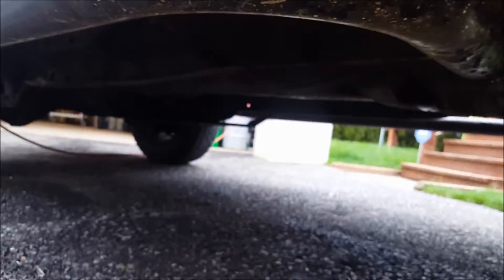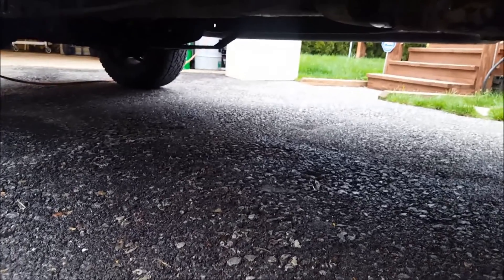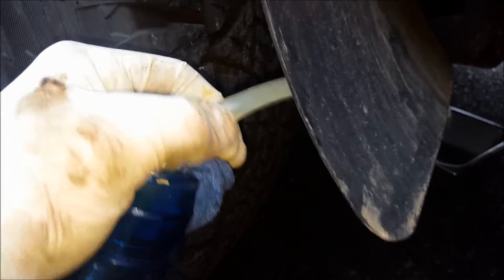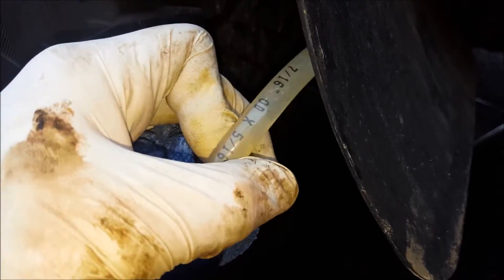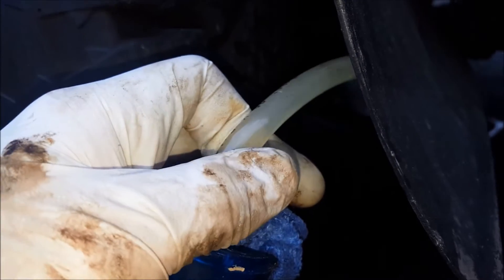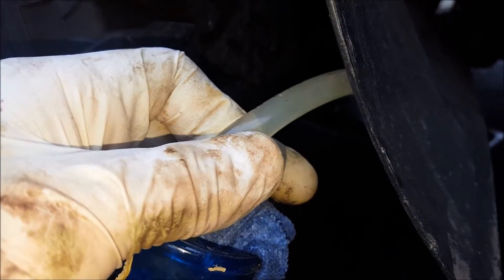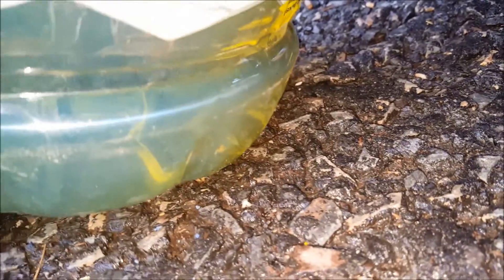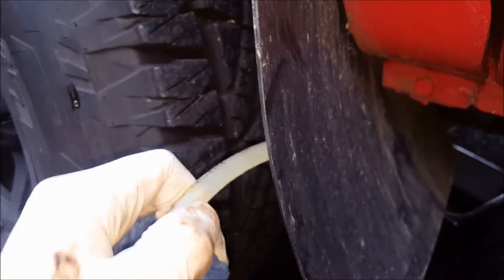I'm going to demonstrate how much air is actually coming in this thing. I did what I was telling you before — hooked up the 7/16ths OD, 5/16ths ID clear hose up to the return line, and you can see all those air bubbles coming out of there. You can look down into the fuel and see all that. No good.